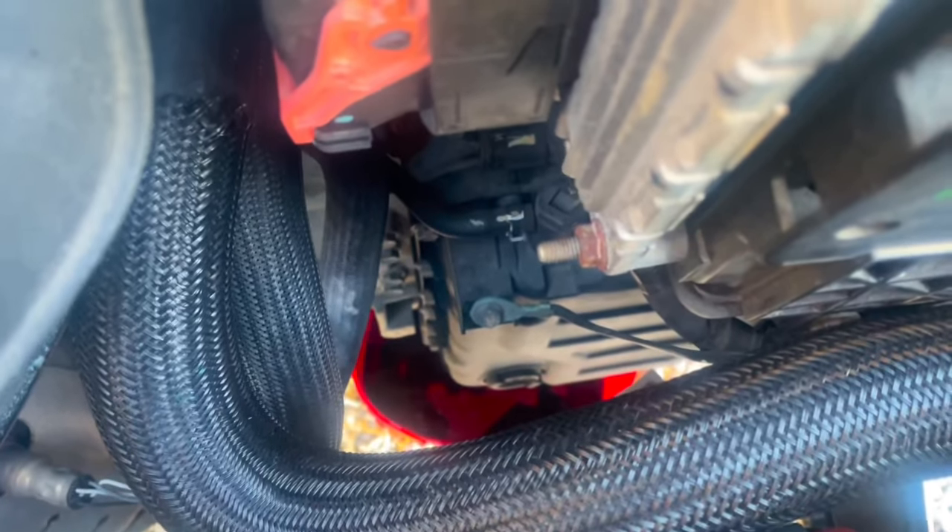It's important to watch because there is a washer in with it, and that will very easily fall out, so just watch for that and make sure you catch it. Here it is draining — this is from under the hood. There's a whole other process we'll get into for putting your transmission fluid in. Right now this is the bolt, and it's a little dirty so I'm going to clean it off.